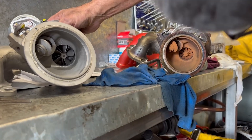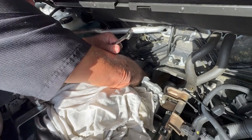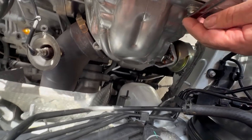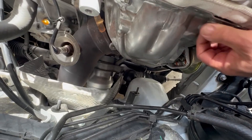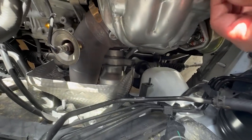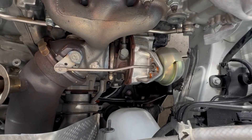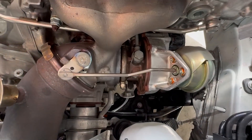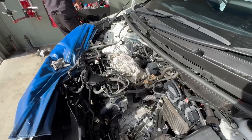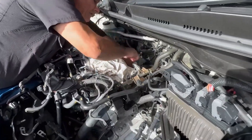What I'm doing is just removing the heat shield first so we can see what's going on in there. There's the heat shield, and it's already got the Sydney Motorsport Engineering exhaust on it - it's a nice big engine pipe, maybe five or six inch. That's pretty much the same thing, just high-flowed. It's a factory turbo that's been high-flowed. Engine pipe and v-clamp - it's just a strap that squeezes the turbocharger exhaust housing. With the engine pipe, it's actually quite a good setup.